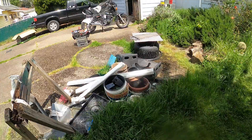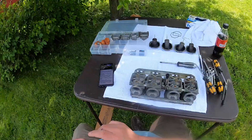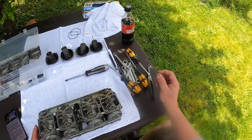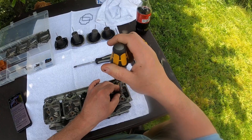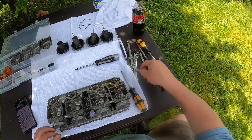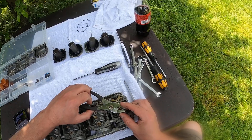The bike is right over there — that is an 83 Honda CB650 Nighthawk. Basically in the process of just rebuilding the entire thing. The main jet and the emulsion tube are basically right on top of each other. I need a 7mm wrench, which I can't find, so I'm going to just see if I can do this without destroying it.